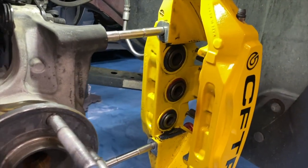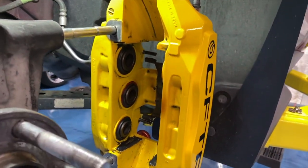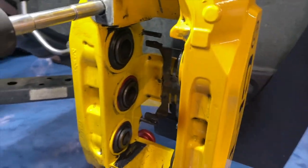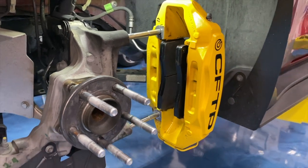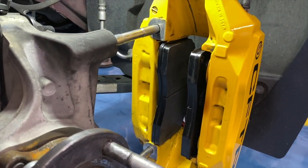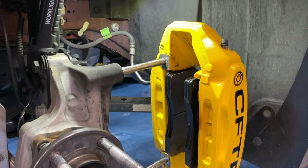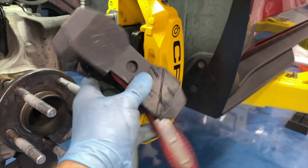For the pad change, I clean up all the old brake dust, grime, and grease, get all surfaces clean, then put new brake grease on all the moving points before installing the new pads. A handy tool I didn't have before is this brake pad spreader — it pushes the pistons back into the calipers. Since the new pads are thicker, you push on the old pads using this ratchet tool to retract the pistons before fitting the new ones.